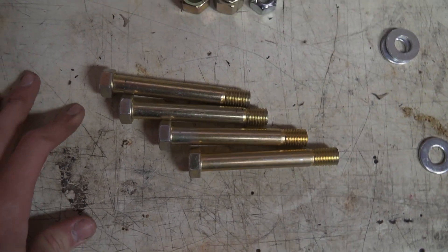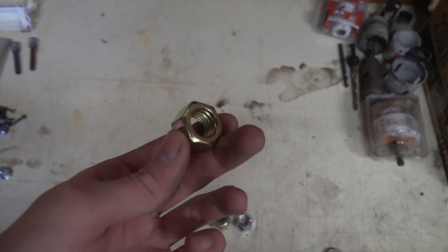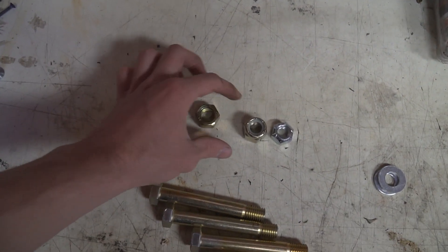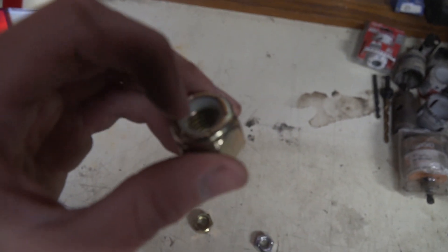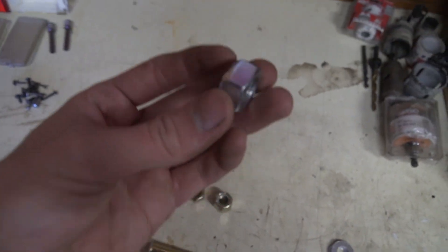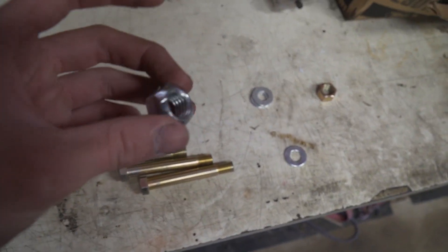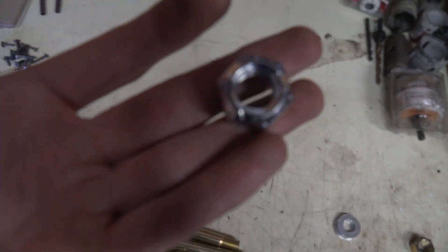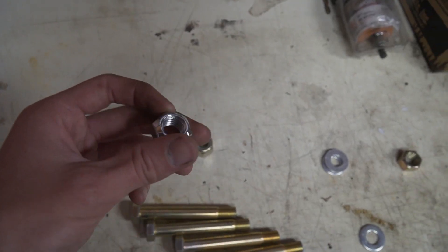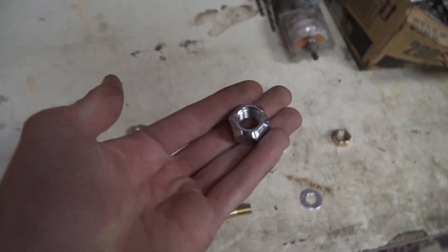I got all the bolts cut down to their proper lengths. Now we're going to go over a few different nut styles. First you have your standard nut — we honestly don't ever really use these on the truck, especially in any applications that are going to be under a lot of vibration. We'll go at a minimum with a nylock, which has a little nylon seal that keeps everything tightened together. But this stover nut is what we use on a lot of our applications. At the top of the threads it's slightly distorted, so it'll be tighter and keep the nut locked on there. It's great in high-temp areas since there's no nylon seal to melt, and these things hold under any vibration — I feel like they keep a better lock than even a nylock.